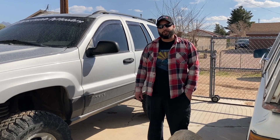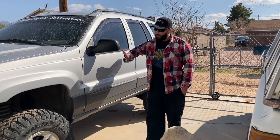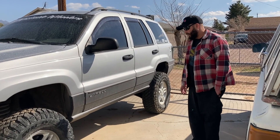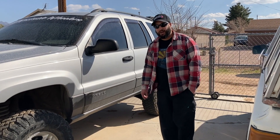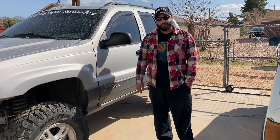What's up everybody, this is Kill from the AZ West Side Wheelers. Today we're working on my 2002 WJ Scrappy. We are cutting the rocker panels off and we're going to replace it with a rock slider. I've got a 2x8 1/8 wall piece of steel tubing from our local scrap yard and we're going to cut that down to size, get it welded up, and we'll see what it looks like when we're done.